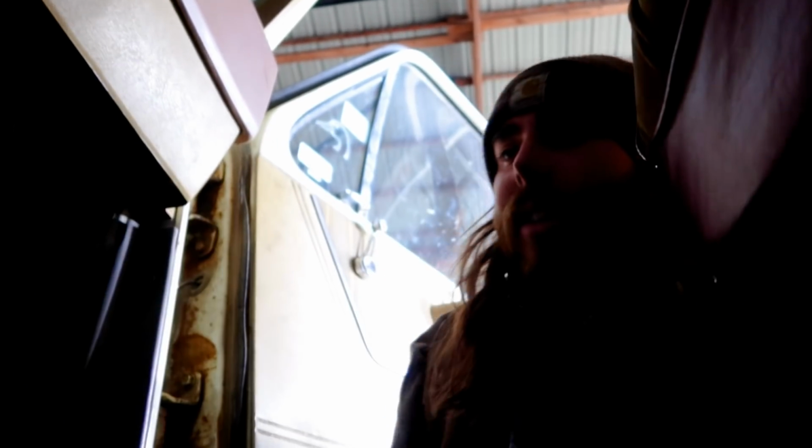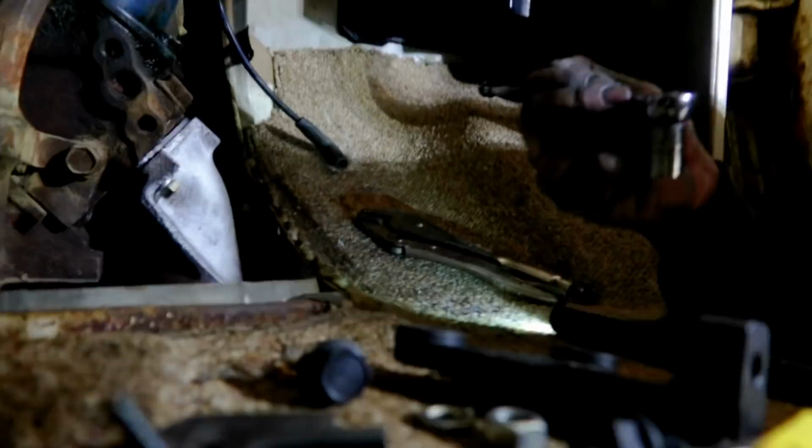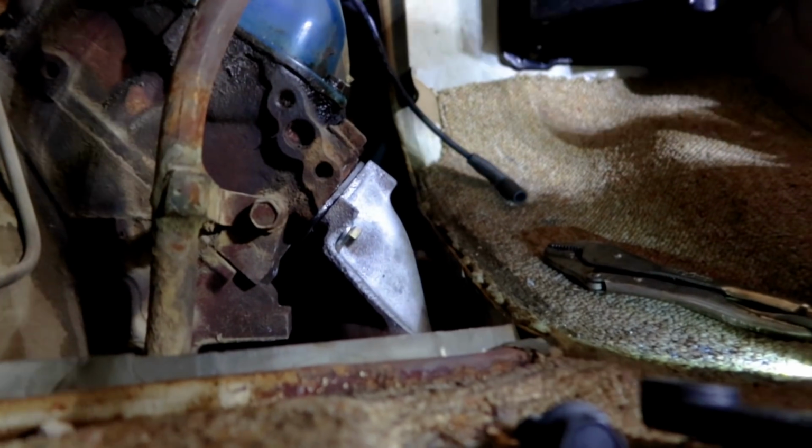How tight should an exhaust manifold bolt be? Use 20 to 30 foot-pounds of torque. How many is that? I'd tighten them as tight as you can. It's not too important as long as they don't come off from a tight seal. Huh. I took the liberty of getting the front bolt in, so now I'm just gonna tighten them down. I already tightened the front one with a wrench. So now I'm just gonna work my way backwards. Get these a couple oogas. That is the torque spec.